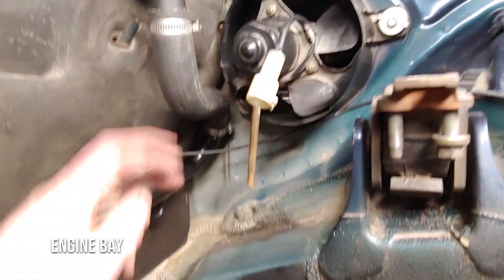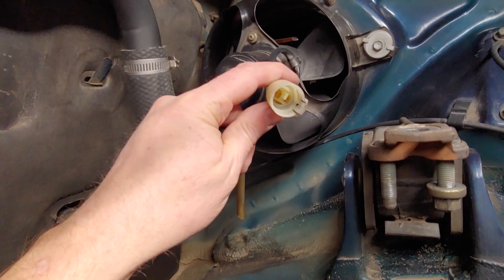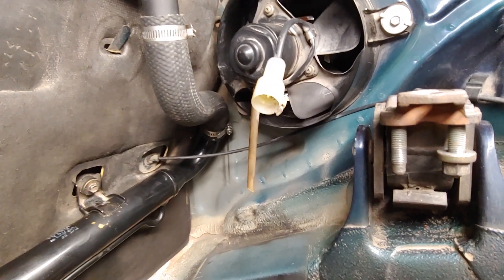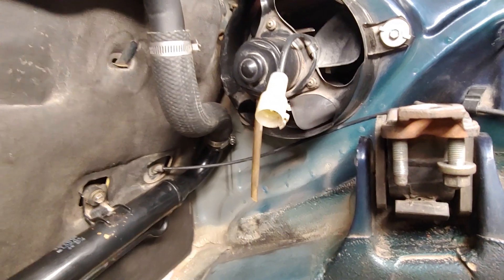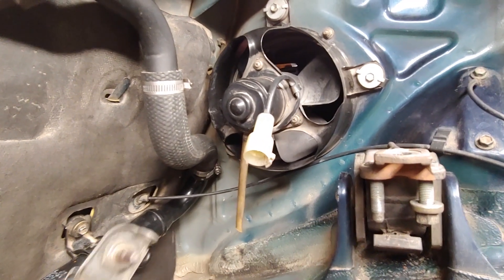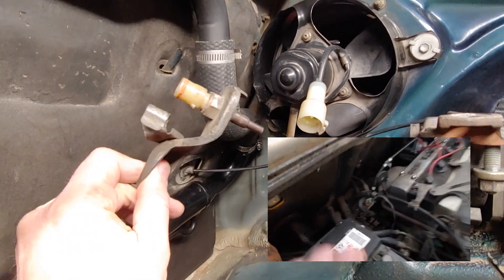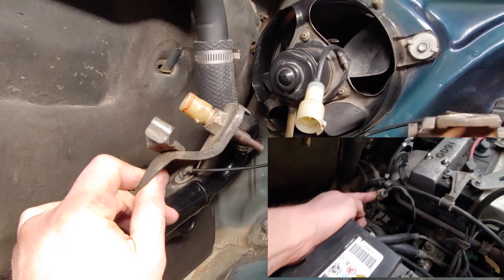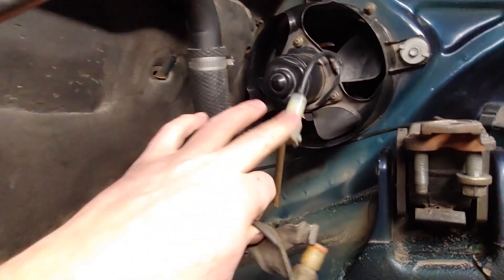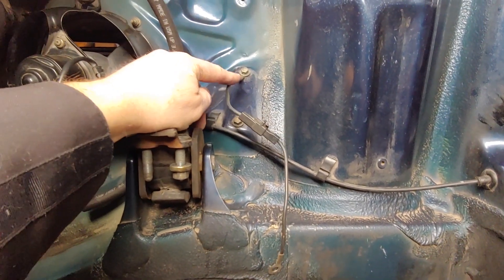The engine bay cooling fan has a connector on it — look closely. The female connector for this joint is on the engine bay harness, not on the engine. When you're looking at that harness and can't find the connector anywhere on the engine, that's because it's still in the engine bay. This cooling fan is controlled by the engine bay temperature sensor, which normally mounts to the front left corner of the engine bay. When it senses the bay is hot, the fan kicks on. A lot of problems come up if everything isn't properly grounded — don't forget this ground wire.